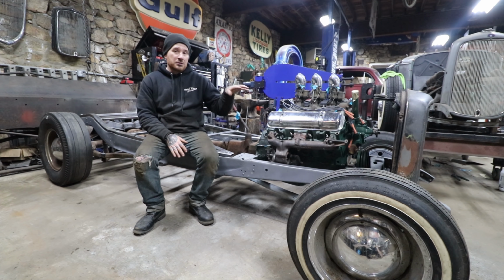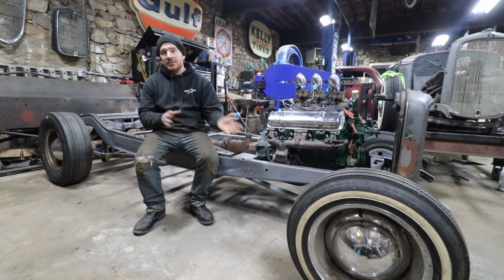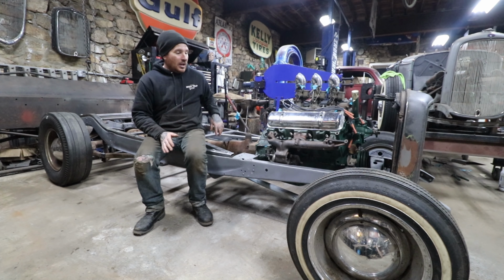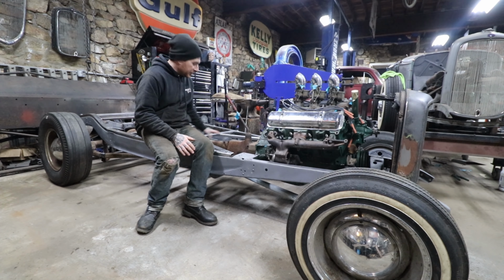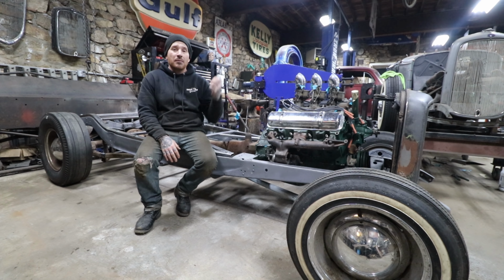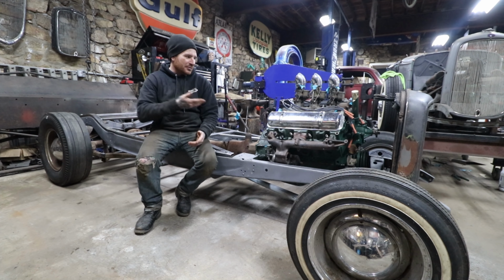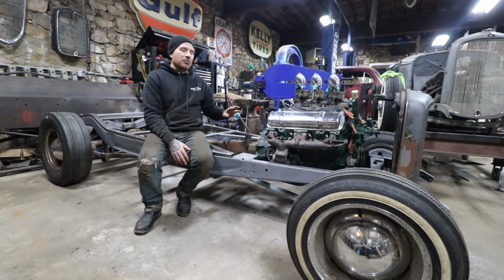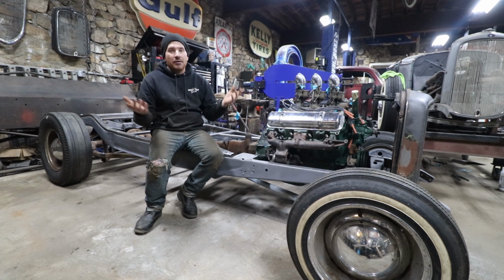But mainly I wanted to get all these bolt holes drilled so that we can just slide this engine and trans into the car, and we can continue to move forward. Now, one of the things I'm really happy about that I made work is I made the executive decision. I ended up leaving this center section of subrails, and I was able to fit the trans right underneath there and keep the floor flat right there. I was a little worried I was going to have to put a tunnel there, but it actually worked out pretty good. Now, it's going to require, and these cars are like that really when you're putting big engines in little cars, if I ever need to pull the trans, I'm really going to have to pull the whole engine and trans in one shot because you can't pull it backwards. The only way that this is all going out is front. But really that's how all of them are.